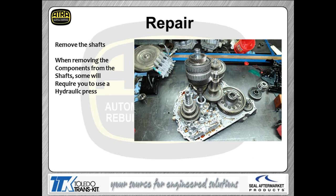After removing the bearing and sleeve, you can fish the gear off and then fish the rest of the shafts out. For shafts that require a hydraulic press to separate, the same advice applies on reassembly: wherever you can, heat sleeves and gears in a toaster oven — not bearings — and they'll go right in place without pressing.